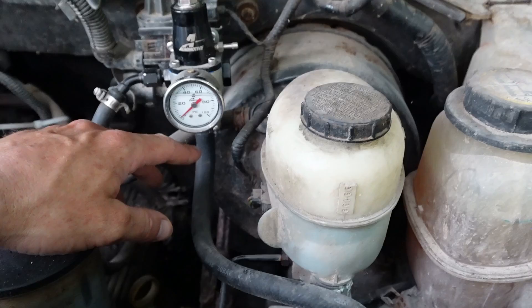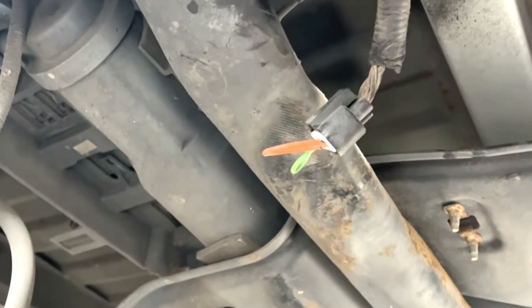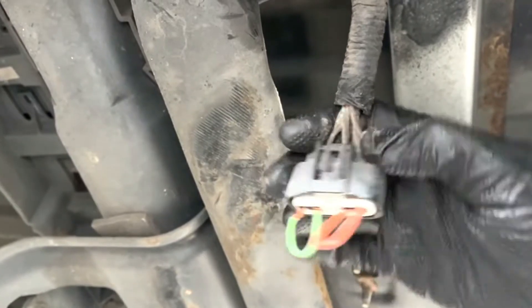The only other issue is how to make your fuel pump run constantly, because as it's set now it's controlled by a module that's broken. Once you remove the broken module, you're going to want to take the electrical plug and jump the outer pins to the inner pins, just like in this video here. That's going to run constant power directly to your pump anytime the key is engaged. Jumping it like this will let you test your system; once you're sure you've got it right, you can cut the connector off completely and tie the wires together with wire nuts and electrical tape, maybe some dielectric grease. There are two other small gauge wires in the middle of that connector that go directly back to the ECM — be sure not to short those or touch them to the power wires or to each other; those need to be encapsulated in electrical tape really well.